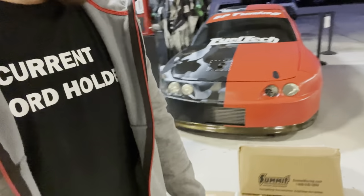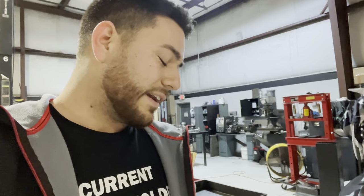In all reality guys, obviously we need a parachute — that's what we're unboxing right now. We got these ordered up, going with a Stroud unit and basically a weld-in DIY tube kit. Our cage as of right now is still steel, not chromoly, so it's a little heavier but it performs very well for what we're doing. We went with the steel components for that weld-in kit and it's going to be welded to the rest of the cage.